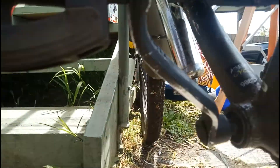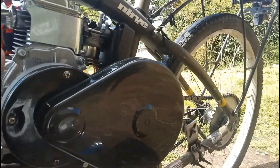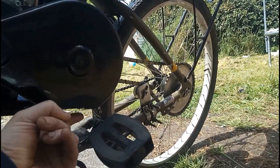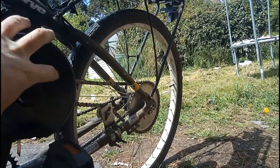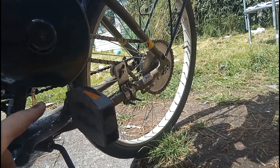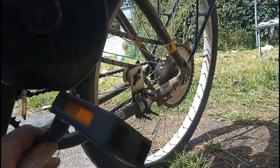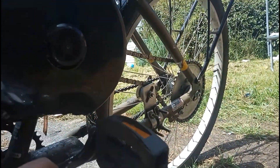Now the ongoing problem is the pedal as it's constantly contacting the wheel. This is what shredded this belt in the first place — it had nothing to do with the quality of the transmission. What was happening is as I was pedaling, the wheel was constantly hitting the driveline and this eventually loosened it just enough to the point where it was shredding, because the bike was working fantastically until I was pedaling. So what we have to do now — as you can see it's already loose — I've got to get the grinder out and take off a whole heap of meat from that pedal.